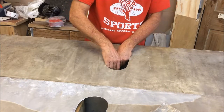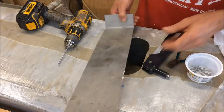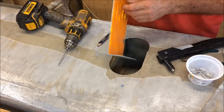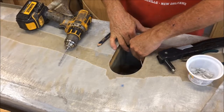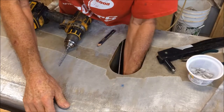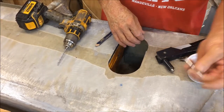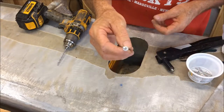There's not much holding them. I got the baffle in the first tank and it went pretty well. Now this is the reinforcement for the second tank — the baffle already exists, this is just to make it stronger. I'm using 3/16ths aluminum rivets instead of screws because I don't want any problems with dissimilar metals.